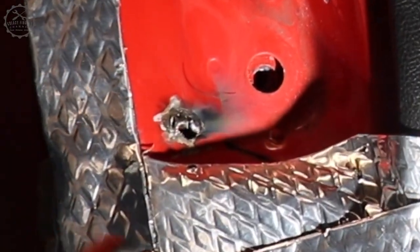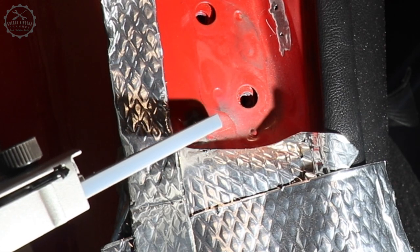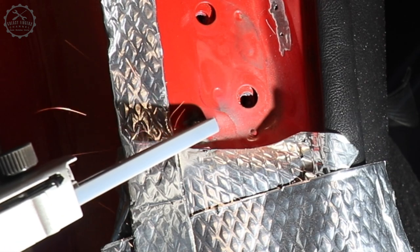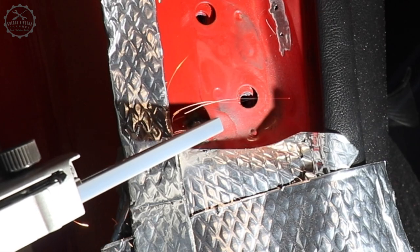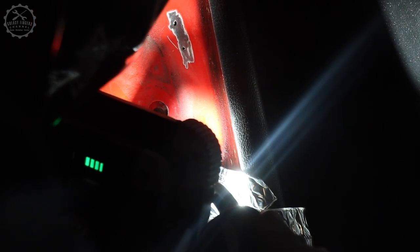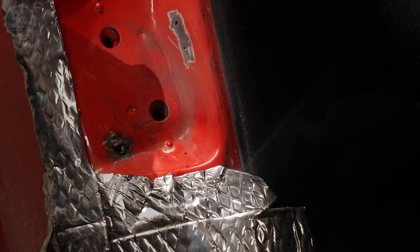The torus mustn't become too fat, because that would only add thickness to the panel, but doesn't help filling the hole. Sanding it all down from time to time helps to keep the repair in plane. Eventually closing the hole required full concentration and more light, and I'm sorry that I cannot offer you a better angle here.